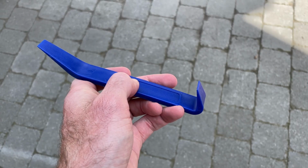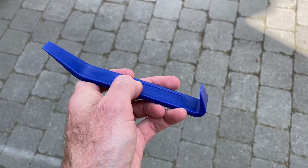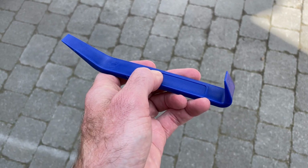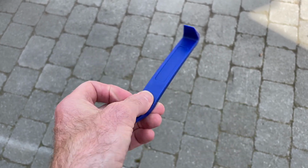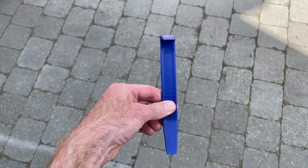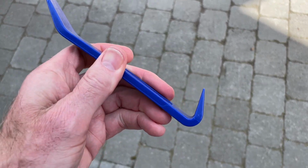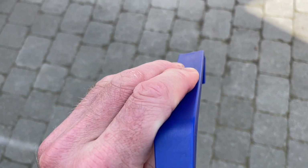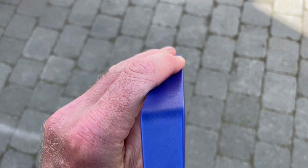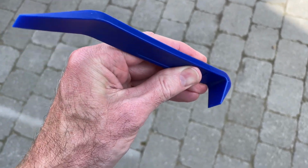So this is the point a day later where you realise the bit of film that was intended to show you how to pop out the black fasteners didn't make it to the cut. So back a day later, this is the trim tool I used, and it's tempting to think you use that end to get it in there, but you'll see that the depth of the tool makes it too long. So actually if you turn it round and hook that up and underneath the back of the plastic where the tab is, you can then very gently, and I'll show you from the side, just gently roll it up like that.